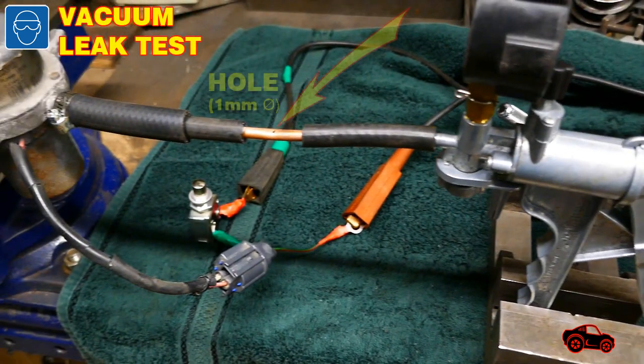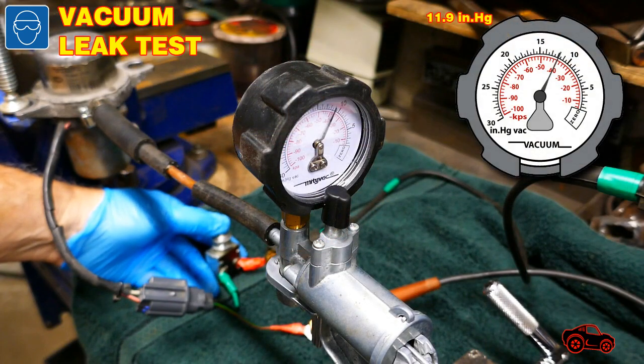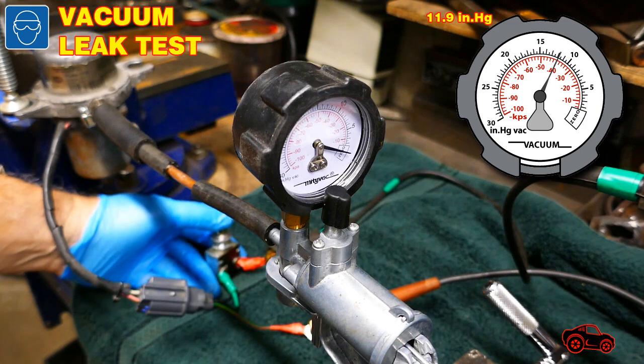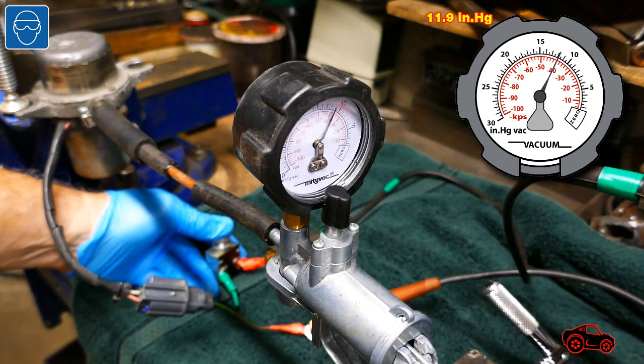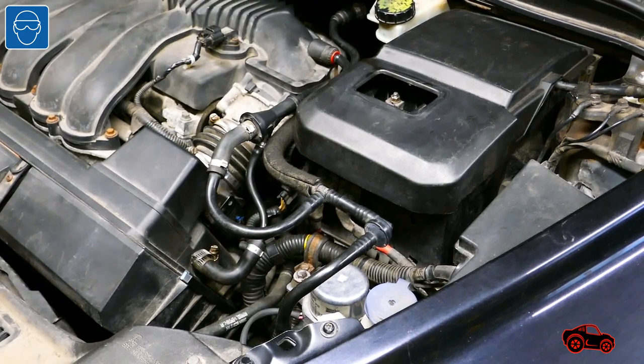This is a test to show that only a very small hole in the vacuum line can prevent the vacuum switch from turning on when the required vacuum level is not reached. Not long after, the work was completed. These 17-year-old vacuum parts are getting out of specs, but at least after several weeks, they are functioning normally.